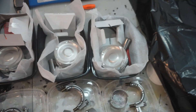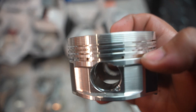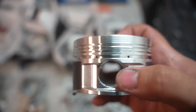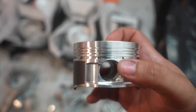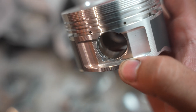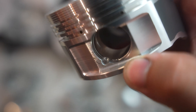Now that this is done, the next step is to install one of the c-clips. As I mentioned in the last video, if your oil piston ring gaps overlap onto the piston pin you'll have to install the connecting rod before you put the piston rings in. In my case that's not an issue — the piston ring is fully free — but I'm still going to put the connecting rod in first because it's easier to handle. I always install one c-clip first. You can see it inside, and you want the c-clip to be in the groove all the way around with none of it hanging in the small overhang groove at the bottom.